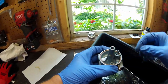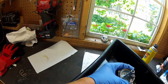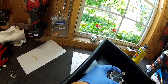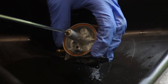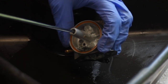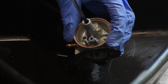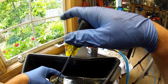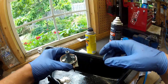There we go. I think I have a small enough screwdriver that I can push that up — there we go. Put the main jet back in. Good quality tools make all the difference here. You definitely do not want to over-tighten these. Just take your time, it should go in nice and easy until it bottoms out, and just give it a little snug — it doesn't have to be Arnold Schwarzenegger tough.